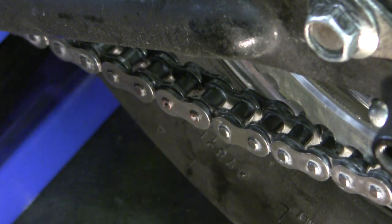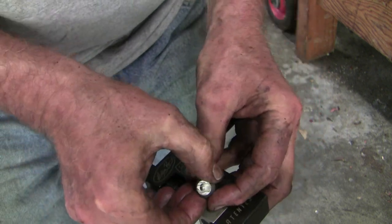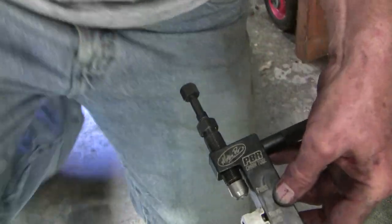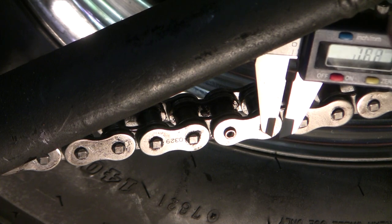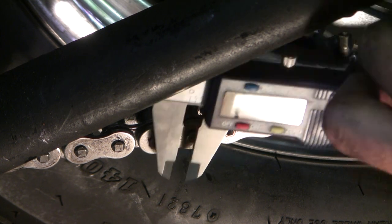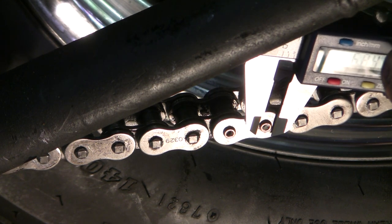At this point let's move over to the rivet phase. For the rivet phase we turn the anvil so the R is beside rivet. You can see what the base looks like there. We move to this little rounded piece because I've got a little dimple in my end piece, and I put a little dab of grease on there just to make it go smooth. I'm amazed at how well this is engineered — there's a little magnet in this thing that holds it steady. Before we start the rivet phase, let's measure: 5.2 millimeters. The rivets on the normal chain are about 5.46 to 5.64 millimeters. So if I can get up to about 5.5 I'll be doing good.